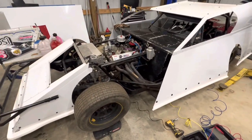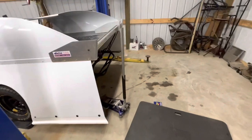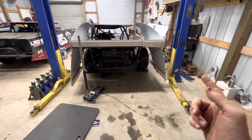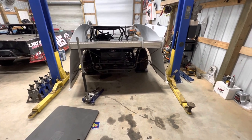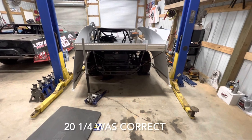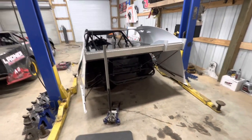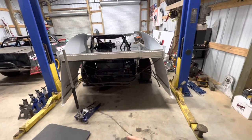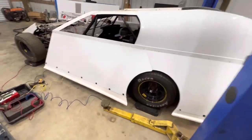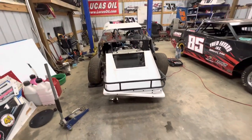That's it as far as scaling goes. I took one round out of the left front. A couple days ago when I was going over this thing, I took both rears off. I took the coilover kit on the right rear — the shotgun spring coilover setup — put it on the smasher, put it at 400 pounds at ride height. I want to say 20 and a quarter measurement — don't quote me on that. And then the left rear, we took the eliminator off, put it on the smasher, and found my center-to-center at full droop. You find that measurement and put it at 200 pounds at full droop. On a 16-inch spring, that's full droop — preload it down to 14 inches and you've got it if you're running a 100-pound spring. Pretty easy.